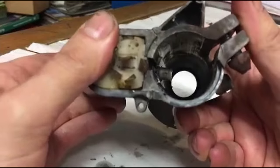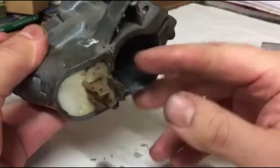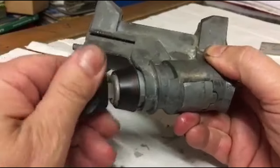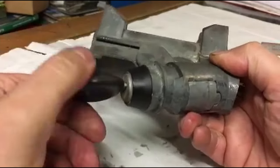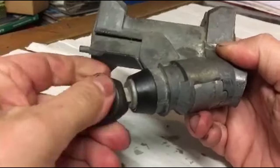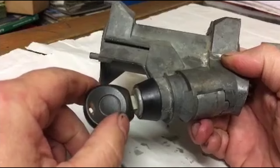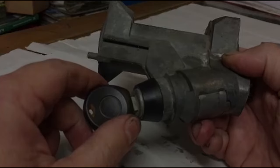Turn it round — if you look up inside, see that thing sticking out there on the left, that's the steering lock. You need to put your finger at the end, push that in, key's off, there we go. It's now located. Turn it on — there we go, all working. Done, simple as that. Hope this video helps — like and subscribe, thanks for watching.